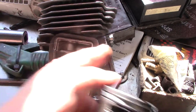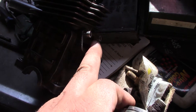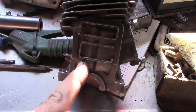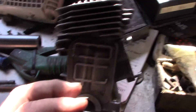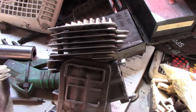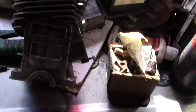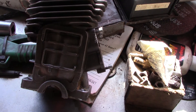At the same time, it's letting in air on your strato ports right here, so it keeps air in there. Theoretically there's no fuel in the strato port — it's clean air. It comes up again, lets it in, and you have clean air coming out at the exhaust. It's all about emissions.